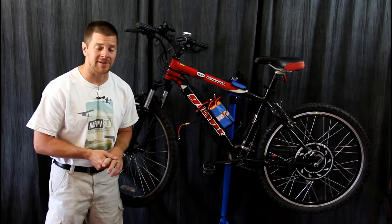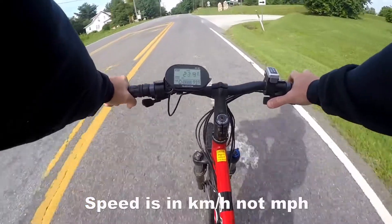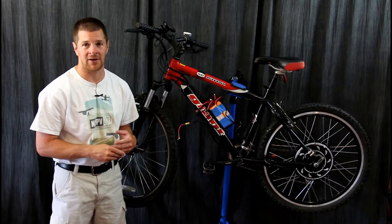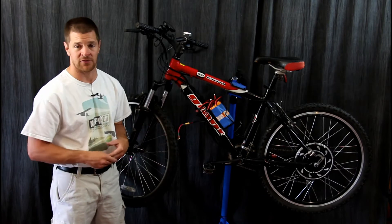How far can you expect to get? How big of a battery should you get? Using just the throttle around here — and this is a fairly hilly area — I'm using about 30 to 35 watt hours per mile driven. This is a 150 watt hour battery I made from a bunch of drone batteries, so I can expect that to take me between 4 and 5 miles. Of course, if you pedal, you'll get a little bit further.